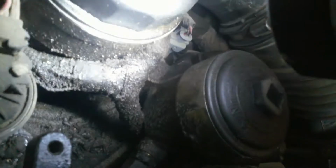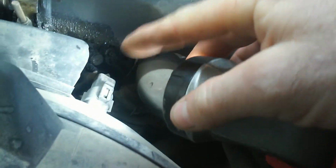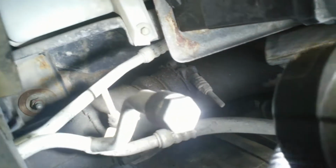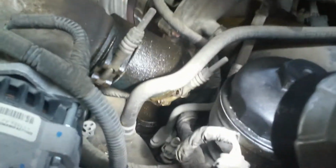That should be dry, that should be clean. I don't know how well you can see all this, but down in there, let's see if I can get the light on it. Right there. Yeah, it's definitely got a whole bunch of definite signs of leaking. We need to be keeping these CAC boots clean. This one down here, the blue boot, was blue. The upper one.